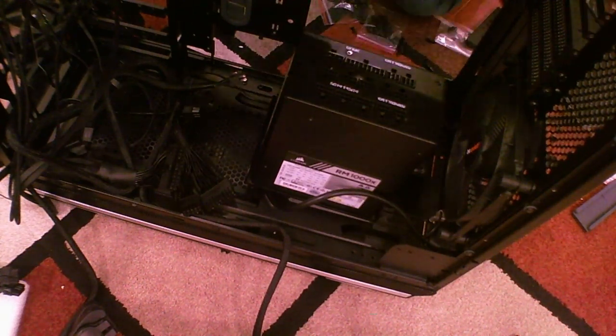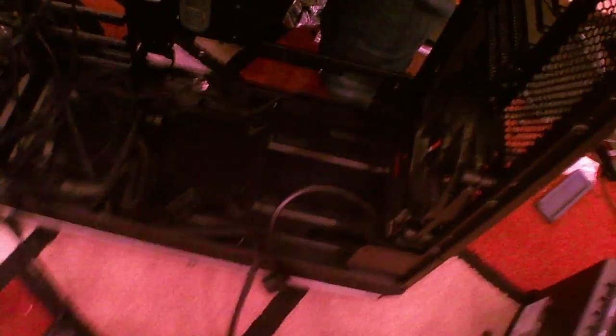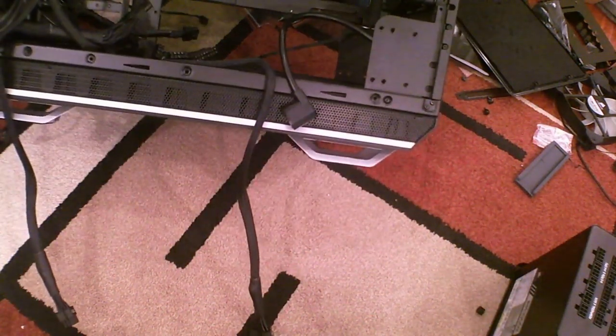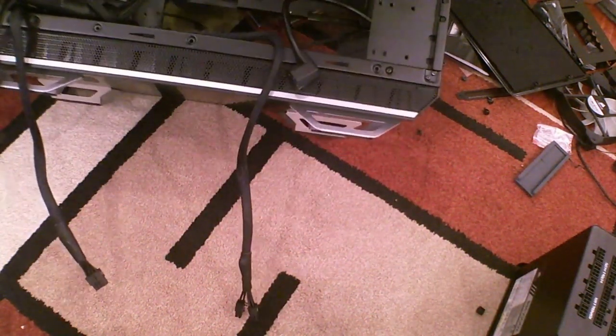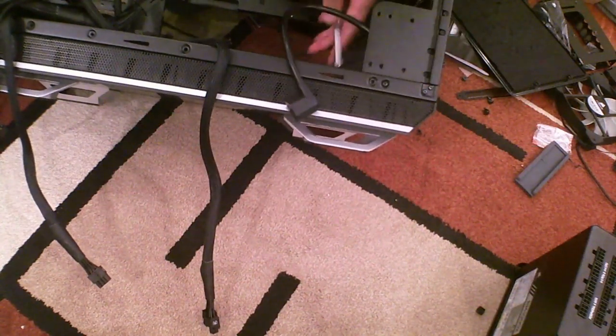Let's unmount this. It can't stay in its cage so we'll have to remove the cage. I keep getting pinker with this webcam — awful white balance. Let's remove the four screws on the bottom that the power supply cage attaches to.